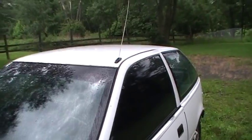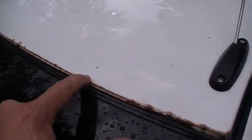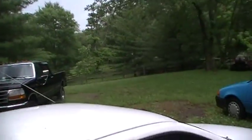All right, okay, back to this thing. So let's look at the outside of this thing. We've got some rust going on here, all the way across. It's nothing too drastic, but it's going to have to be sanded, maybe a slight fill. Rust spot, rust spot, rust spot, rust spot. Rust spot on the roof. Another one like that over on the side. Here's some here, a big old scratch mark where it rusted. It's got no appreciable dings in the roof or damage.